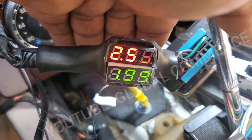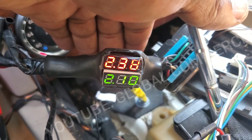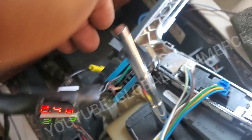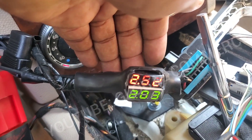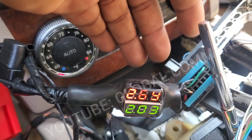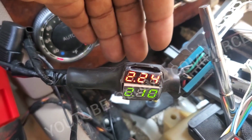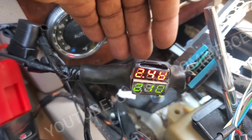Now if you see that, it looks like the voltage is normal right now — but you've got to be careful with that because my scanner is plugged in. So we're seeing actual voltage reflecting from the bus and my scanner. You always need to do a test without your scanner plugged in to verify the voltages you're getting on the bus. That's very important.